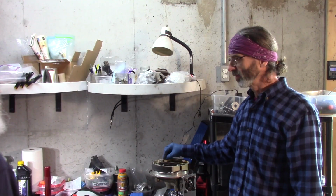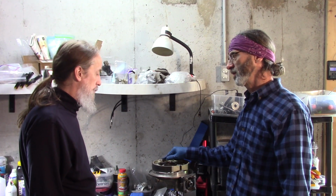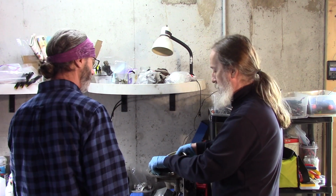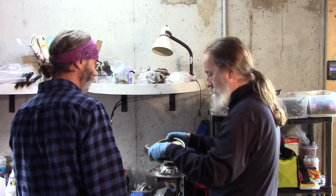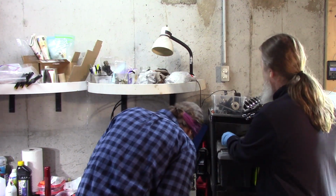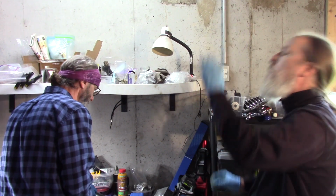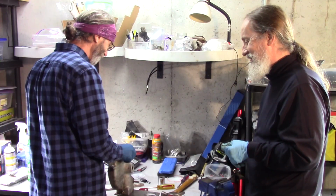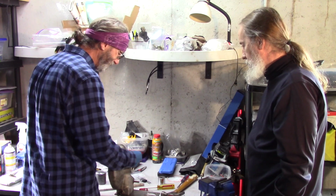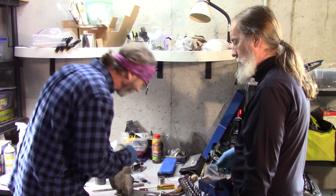If I had to do this all over again, I would have marked the brake arm, and then I would have put the brake arm on. Caused an issue where this thing was going up and down as you were pressing. That was really weird. It's actually easier to take off. That was easy to take off. See, this washer got bent up a little bit. Reasonably flat. Yep, the washer goes in first. Washer was just flat. Felt ring, and the brake arm. It goes pretty much straight down, but a little bit back.